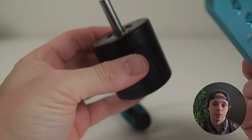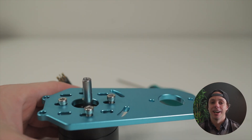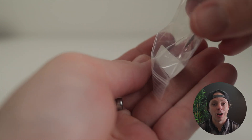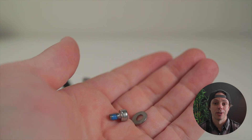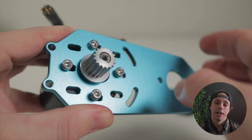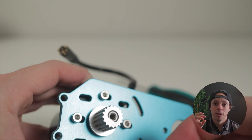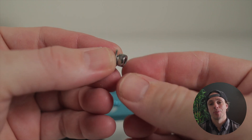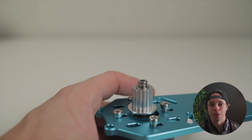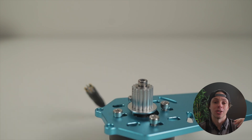This is a single motor board. You attach your little tiny motor onto the motor plate, which is really cool — it's anodized in a really nice bluish teal color. All the hardware has a little bit of Loctite on it pre-applied, so when you assemble it none of those bolts should rattle loose. From there you take the motor pulley, which drives the belt, and slide that onto the motor shaft. Normally these use a little set screw which is tricky and a lot of people have motor pulleys slip. But with this design, you just put one bolt right in the end of it and it tightens down — it's a really simple design. I actually think this should be how all motor pulleys are for belt drives. The shaft of the motor has a threaded hole so you just bolt it right in.